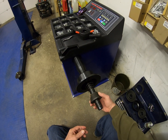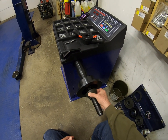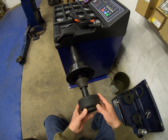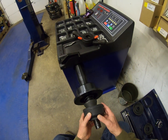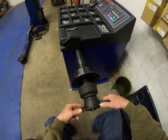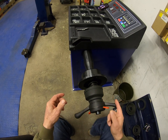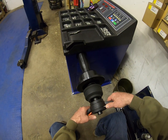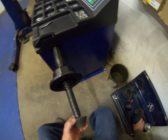Another way to do it would be to turn the cone around, put the wheel on, and then this device here is basically a pocket that goes on the outside of the wheel. That pushes the wheel up against the cone. This here is the lock nut — it's got a quick release on it, so you put the wheel on, quick release, screw it on, and that pushes it up against the outside of the wheel and centers it on the machine. Let's go ahead and do the first configuration, because that works best for the wheel I'm going to use.